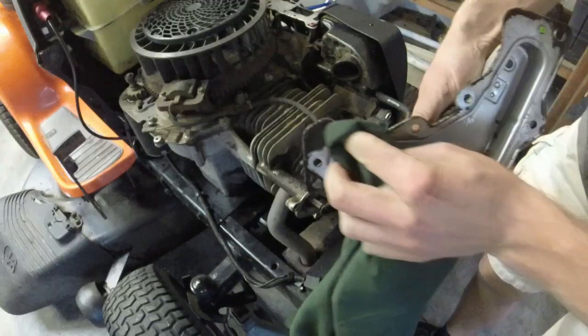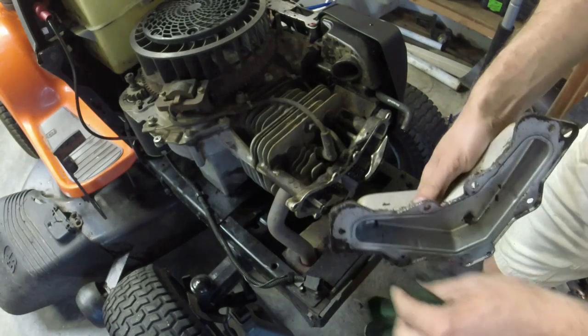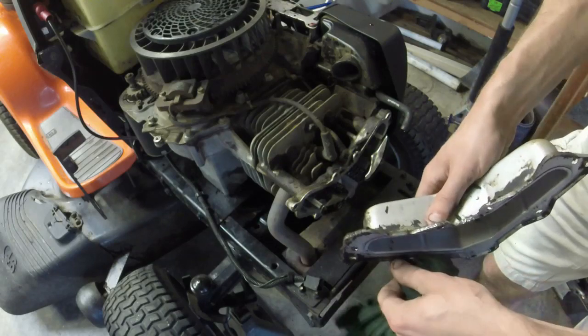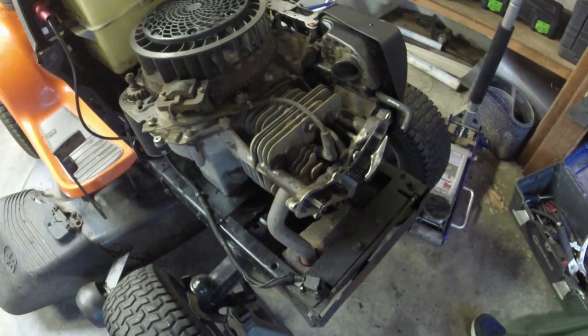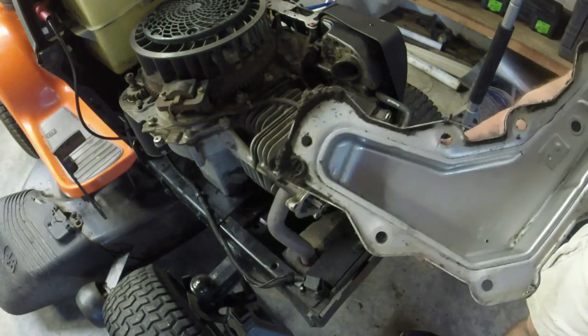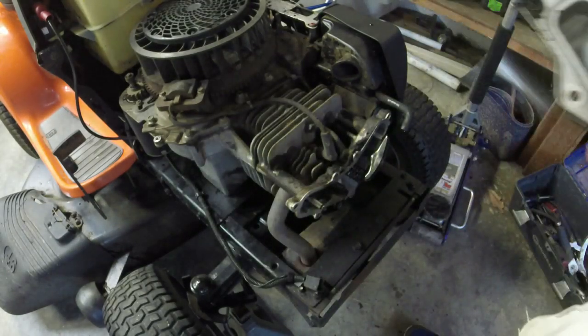We're just cleaning this off camera. Leaking oil like nobody's business, but I mean, it's just the valve cover and the sump and the mounting bolts. Two things that I've seen out of Kohlers, so neither of which are crazy. But she's still running good. So I'm going to get some RTV sealant, clean this up a little bit more, and I'll seal her up. We'll catch you in the morning.